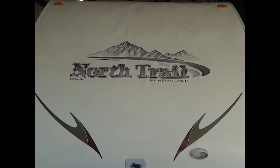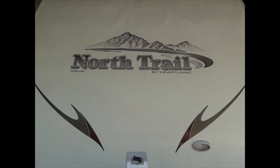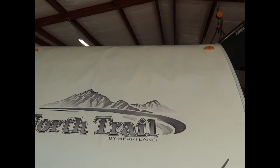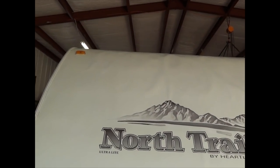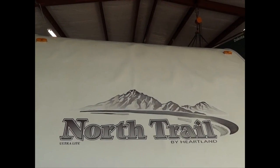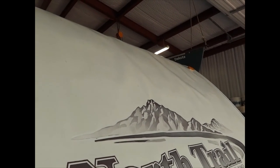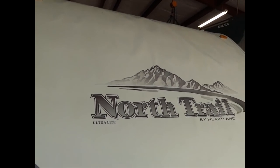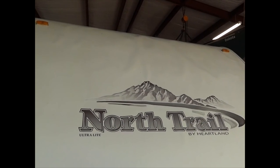This is a project we're going to undertake. We've got a 2009 North Trail travel trailer with a fiberglass front cap which has numerous wrinkles and deformations — it's undergoing what is known as delamination. The fiberglass has become unattached from the substrate underneath, resulting in these ugly wrinkles and looseness. Looks like big giant varicose veins on the front of this trailer. We're going to be removing the front fiberglass and replacing it with aluminum, which is commonly used in trailer construction nowadays.